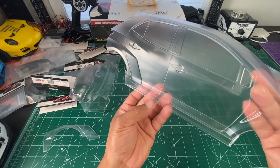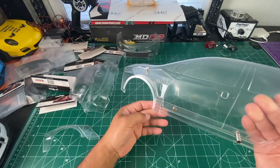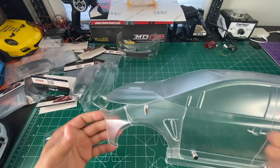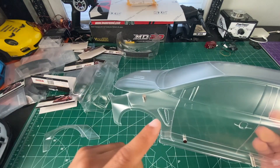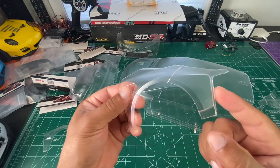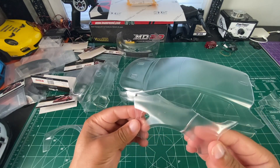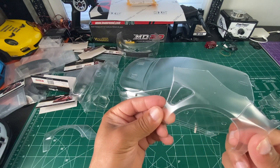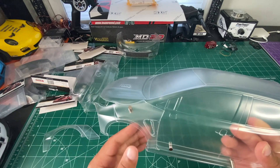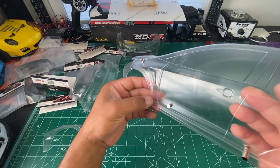That's what it's going to look like if you do the side skirt. And if you're doing the rear fenders and front fenders, you'll need those too. When you do the front over fender, as you can see, it goes on just like that to the top — there's no cutting of the main body. You cut the other fender just to size like that. Here's one that's already cut — rough edges, just shave it off with a knife. You need to cut out this hole here; mine already came pre-cut, but now you know what needs to be cut.